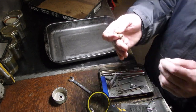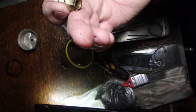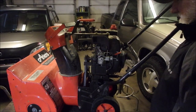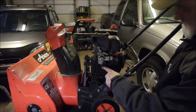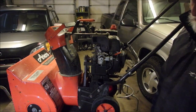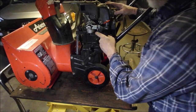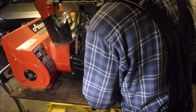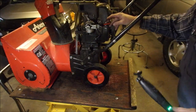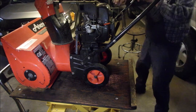I think there was a plug. Look at that. All right. I just cleaned the jet, the mini hole, tiny, tiny hole, and I squirted some fluid into the idle screw. And now we're going to start her up again. Should see fuel leaking out of here. You can hear it now. Yes. It's going to start. It's going to smoke a little bit. We got 3/4 choke, 3/4 throttle. A little bit of this, a little bit of that.